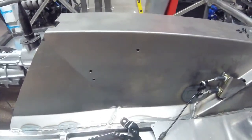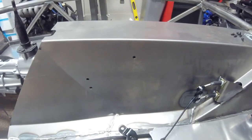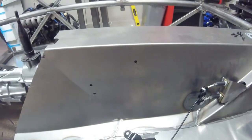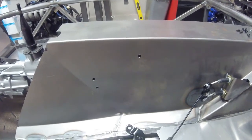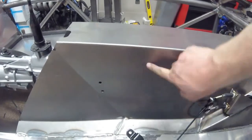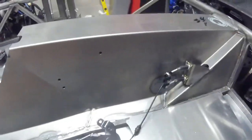Unfortunately you can't pull the parking brake until it is fully mounted to see if it's engaging correctly, so it's a little nerve-wracking — especially if you have a powder-coated chassis, because if you drill those holes wrong you may need to drill them again farther forward or farther back. Luckily mine is not powder coated yet, so if I don't like this I can always fill these holes with some weld, grind them down, and remount.